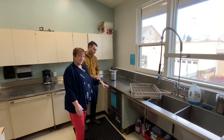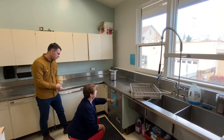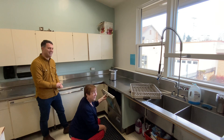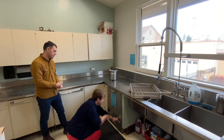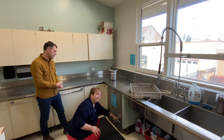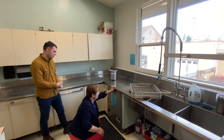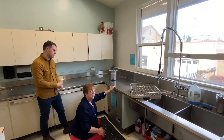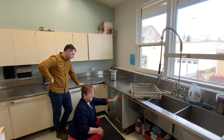When you come in, the sanitizer takes a while to heat up. Sanitizer operation instructions are on the door, but also on the wall, because once you have it open, you can't read the directions on the door. First thing you want to do is hit the on-fill button — that's the first button — switch it to on fill, and close the door. Make sure you push it down to latch. That will fill the tank with water.